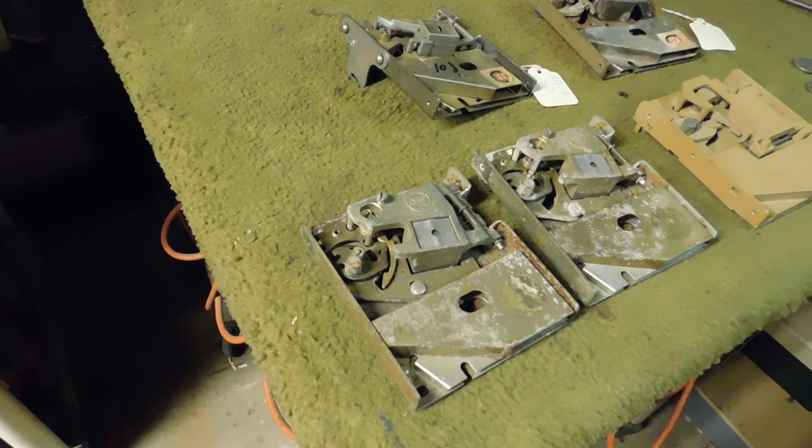And we're going to do it about coin mechs, and basically how you adjust them and install them in an arcade machine. Now the thing you need to understand about coin mechs is that the adjustments are not what you kind of think they are. There are mechs out there where you can basically have universal coins. So if you wanted a coin the size of a penny or a dime or a nickel or a quarter, you can make adjustments on that specific mech to hold those types of coins or the dimensions of those coins.